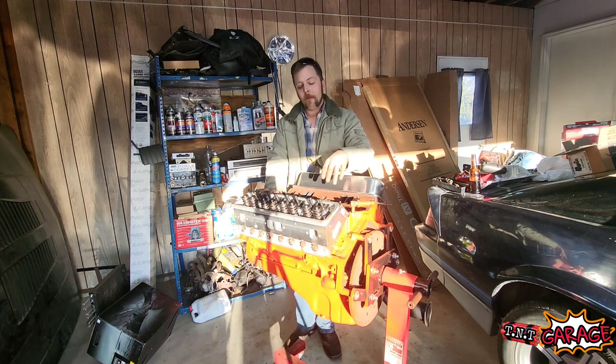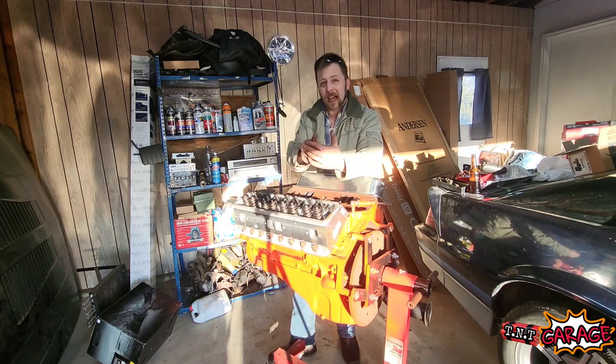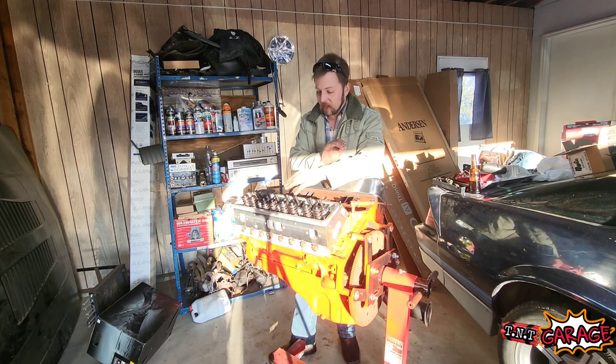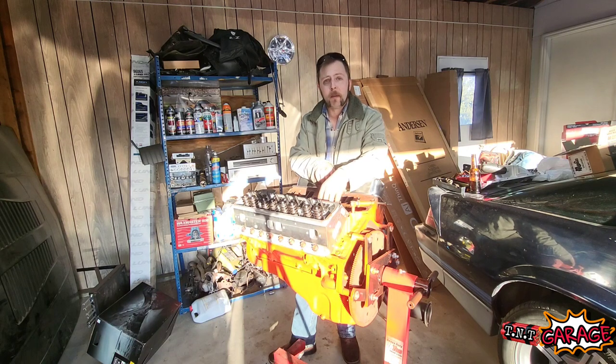So the next video, we're going to pop this 350 apart. There's not any real big ring ridge on it, so we don't have to worry about that. No scoring in the cylinder walls, at least on this bank. We'll hone it out. We'll re-ring it. We'll measure the crank. We'll measure all of the main journals and the rod journals to make sure everything's going to be okay. And this will be a brand new 350 after all.